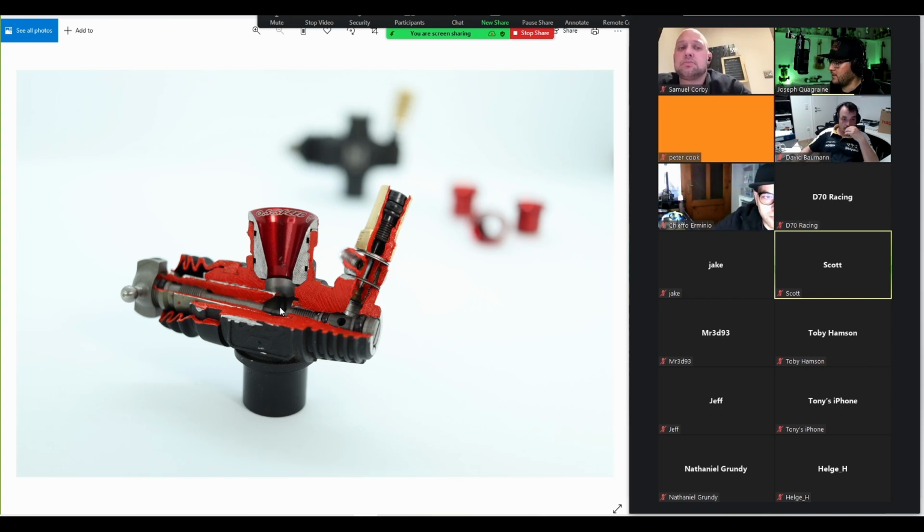So in this situation, what you have to do is open up the idle gap more. So you open up the idle gap to say maybe 0.6 millimeters. That allows more air to flow into the engine, more oxygen, and then you can open up the low speed needle a bit to allow more fuel to enter also. And then you can get even an older engine to still idle and run correctly. So over time, the idle gap you need will change. You will need a slightly larger idle gap with a more worn out engine when you start having issues idling.